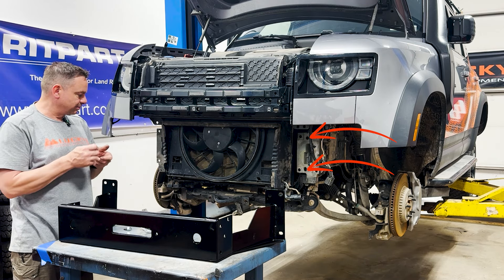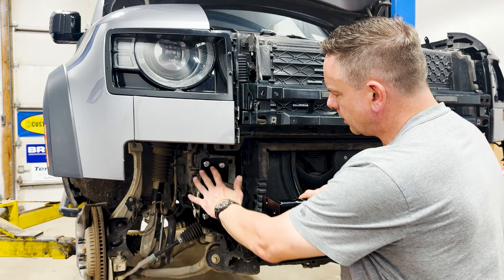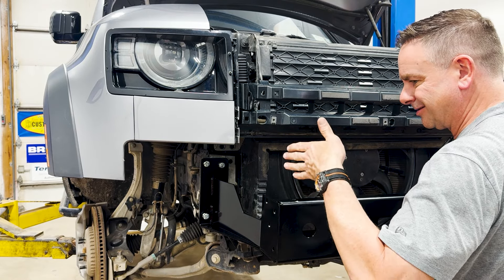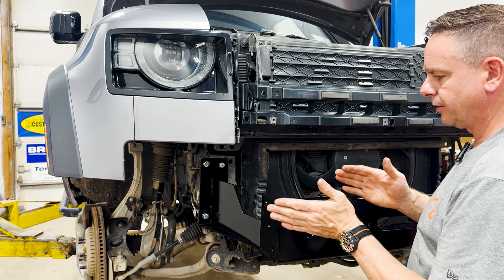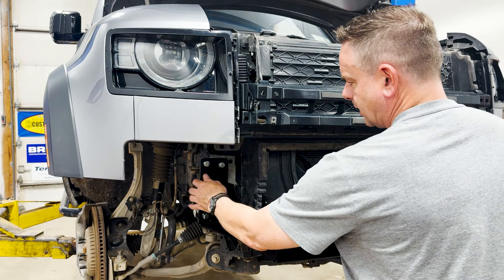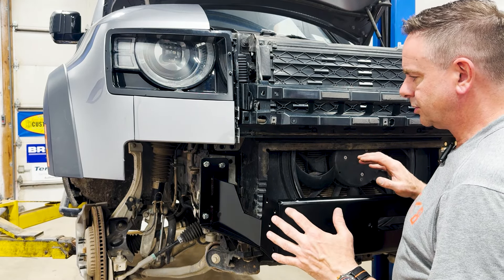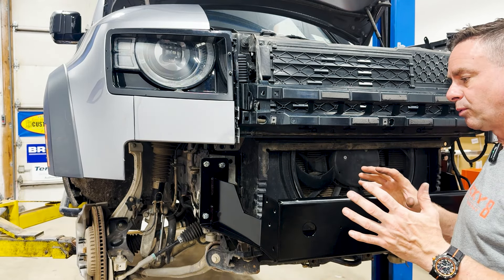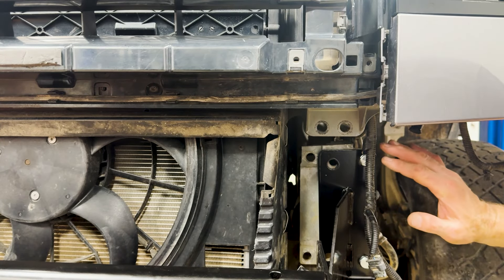In the interest of speed I'll just put this on and we'll come back and have a look at it with all the hardware in place loosely. You want to make sure that the bumper center section is in fact in the center — you can wiggle it one way or another — and then when you go to put the wings on, one side is going to stick out farther than the other and look silly. I tend to leave it almost all loose, get them close, but have the ability to move the bumper center section back and forth.